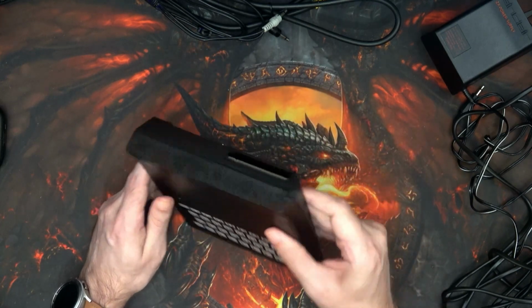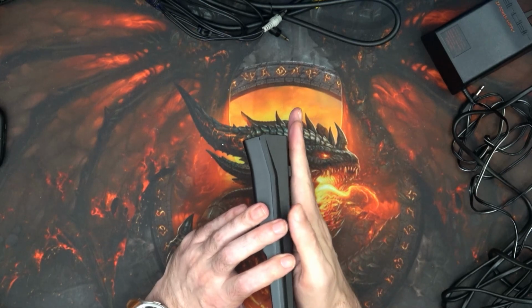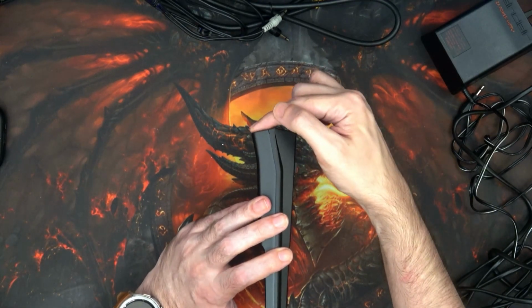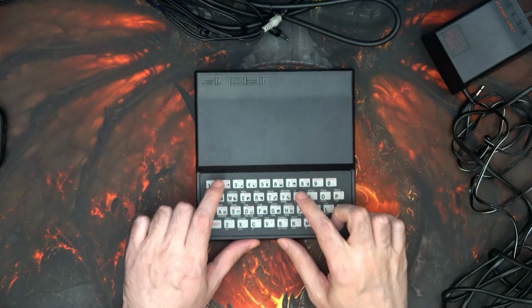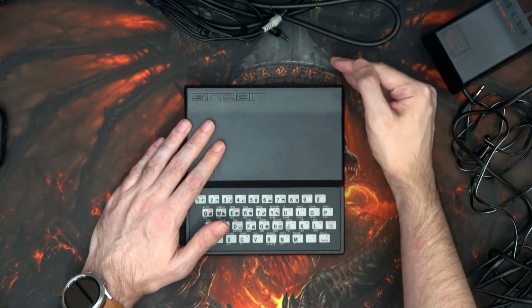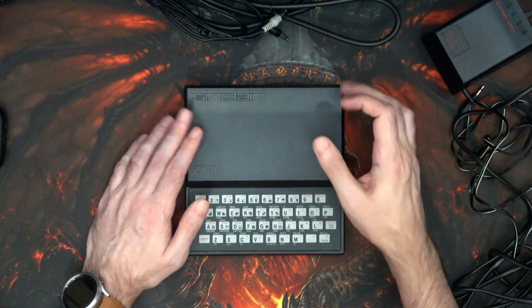Basically it would fit on at the back, especially the Sinclair designed one, would fit flat sort of at an angle, because you can see it's not exactly a right angle, it's just a little bit not quite 90 degrees, and then there's the wedge to go across the top as well, so it would lean backwards, which meant when you were using this fantastic keyboard with your man-sized hands and wobbling, it would actually move the computer about, which in turn would wobble the RAM pack. And the ZX81's a bit flaky in the realms of RAM pack wobble, and it would crash, and it might do a reset right there and then, or it might not.